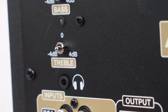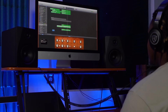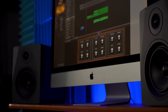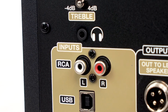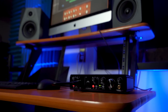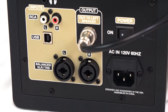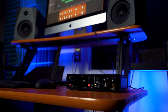There is a headphone jack that allows you to plug your headphones in directly to the speaker. This will mute the speaker and is especially useful if you want to use these speakers for video editing and don't want to use an interface. It allows you to quickly reference your work on headphones to make sure it is cross-compatible for different playback devices. There are RCA inputs if you want to use a 3.5mm to RCA cable or RCA to quarter-inch cables to run into your interface, a USB input to connect through USB to your laptop or computer, and balanced combo jacks to accept XLR or quarter-inch TRS cables to run the main left and right outputs of your interface or device into these speakers.